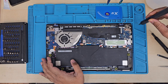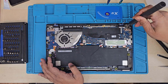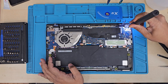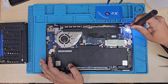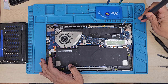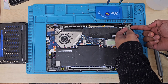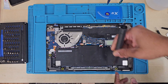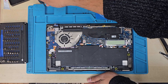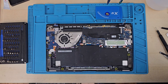You might say this screen is being replaced anyway, so we don't need this cable — but still, you can practice doing it properly so when you connect the new one you'll be absolutely accurate. The alignment has to be correct before you plug in or pull out, otherwise the LCD could be damaged, and that might also damage the actual GPU. Never do this replacement with the battery connected — many people try to replace the screen but end up shorting the GPU and damaging the main board because they left the battery connected.